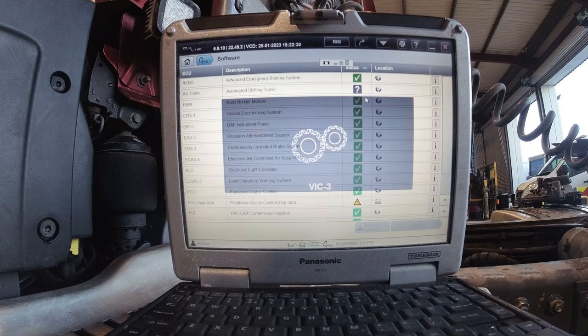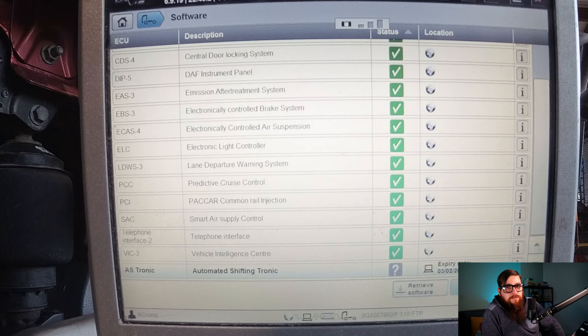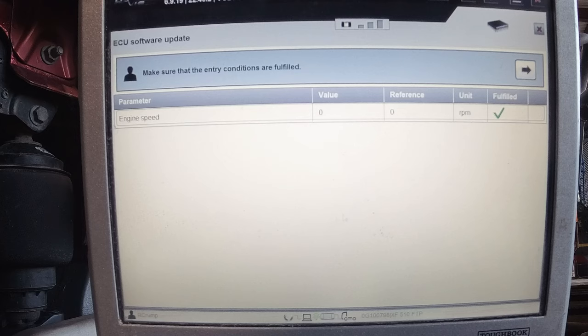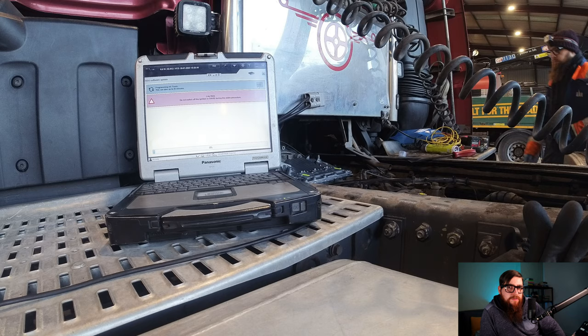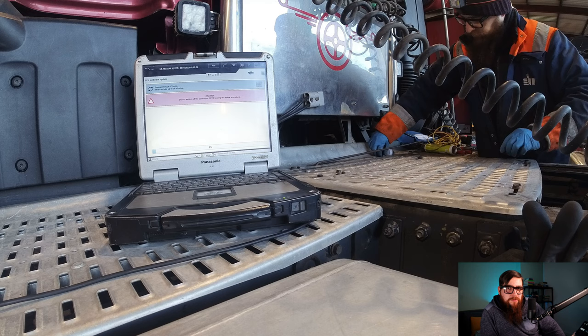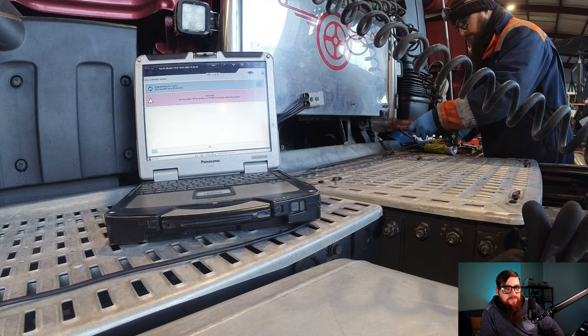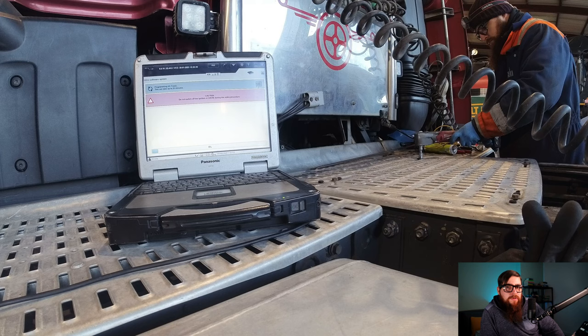Now for the software. With Davey back in the vehicle, we can look to pull the software for the ASTronic ECU from the back office at DAF. Unfortunately, all of these units aren't supplied with software. With the requirements met — i.e., the truck not running — I can leave the software to do the update on the ECU while I put the catwalk and pipework back together. I'd love to know how you managed to fit these modulators. These gearboxes have been around since I was an apprentice — I remember them being fitted to Foden in 2003, but with DAF using Traxxon since 2017 in the CF and XF, do you still do much with these gearboxes? Let me know down below in the comments.